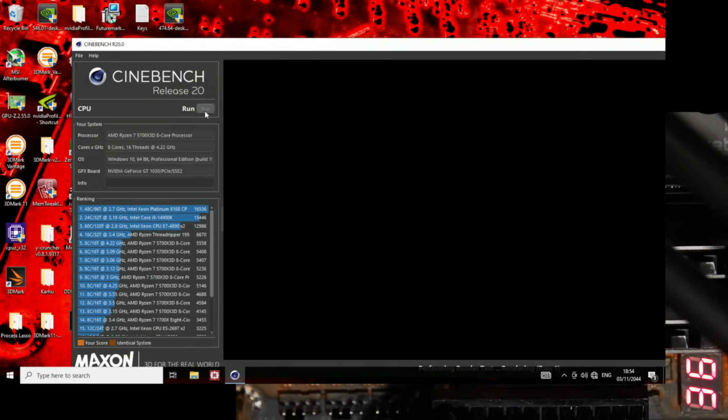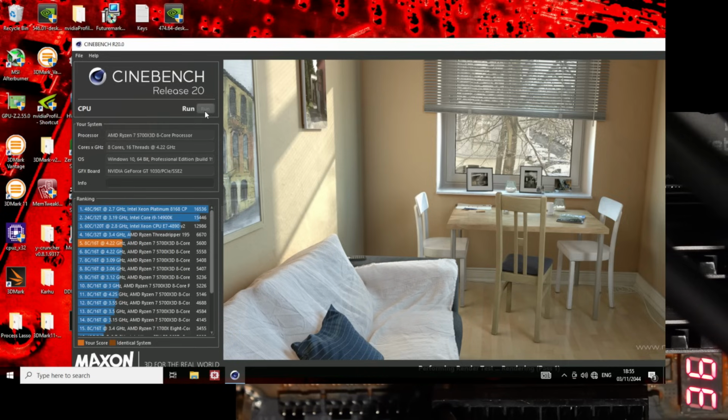Which is not very fun, and then you have to go through a full system reset, because the board just doesn't deal with that very gracefully for whatever reason, or the CPU. I don't actually know what it is locking up. It just gets stuck in a loop. Actually, it looks like an Infinity Fabric initialization issue, or a memory initialization issue. Oh well, that's kind of annoying.